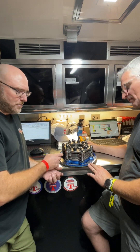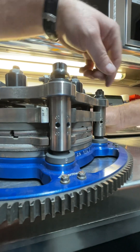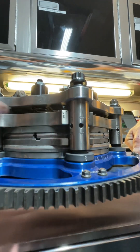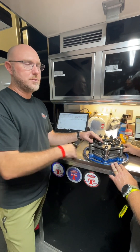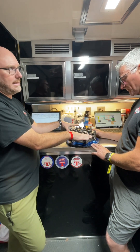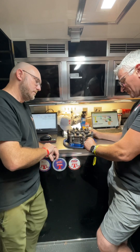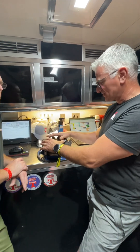We do that by changing the height of the stand. You can see these adjustable stands here — they've got numbers in them. I can turn that because this stand is threaded. What that's doing is allowing us to set the total distance of the clutch to the exact same height every time. When we go out and make a run and it burns a little bit of clutch disc off, that thing's going to want to sit down farther, so the consistency of the clearance is critical.